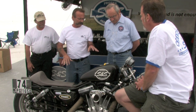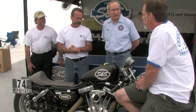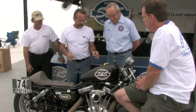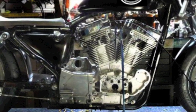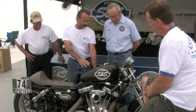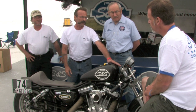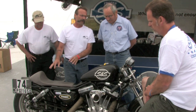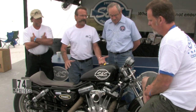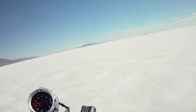Okay, well we started out with a 1998 Harley-Davidson 883 Sportster with a 5-speed and what we did was we kept the 5-speed and we married it to this beautiful S&S Superstock motor. S&S sent me a mock-up engine so that I could modify the chassis so that it would fit into the bike itself. I basically dropped the cradle one inch to accept the motor. We added five degrees to the steering head to increase rake and trail. We added four inches on the rear swing arm to help us keep a nice straight line machine. It's very stable, it handled really well this year on the track and it's just a screaming machine.